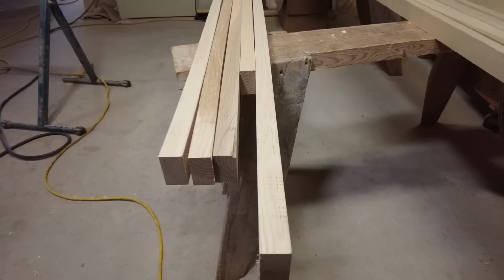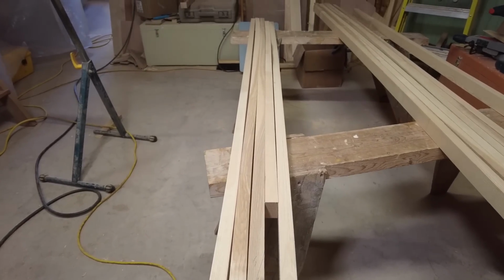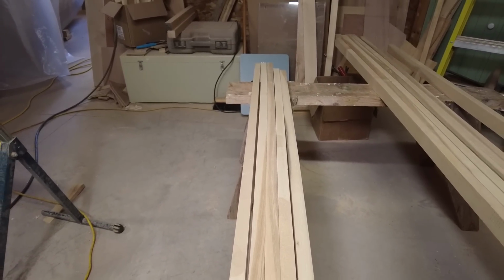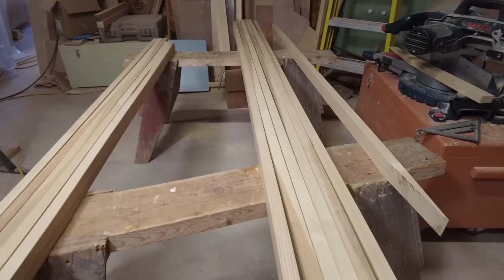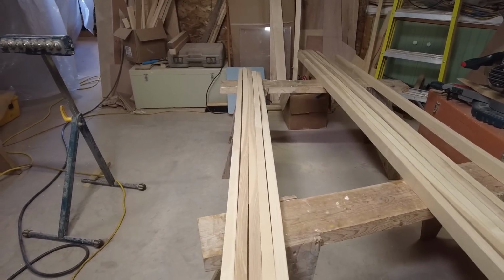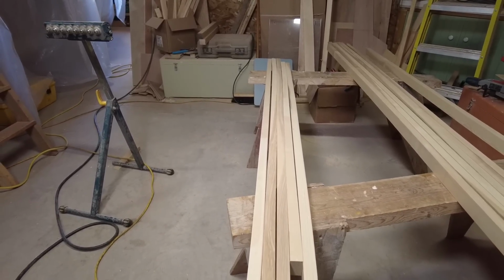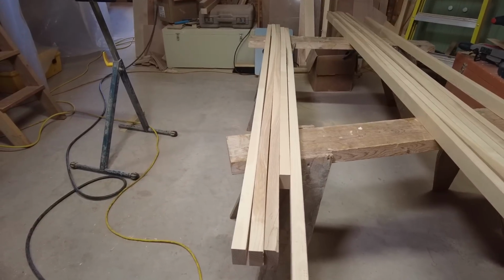It's wood. I've trimmed off a lot of the broken and shattered bits from the ends here, but you can see just in this line right here, the boards, I've pressed them together, but yet you can see these big gaps. And it's unfortunate that they're not all true and straight. I've picked the straightest ones I can for the long lengths, but even those ones have defects in them. But taken together, once it's all scarfed up and there's about 10 knots of wind in the sail, all these are going to bend in the right direction. So I'm not worried. But right now I'll just finish cutting the scarves on the shorter pieces.